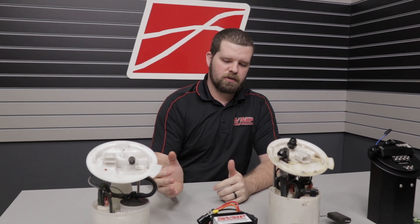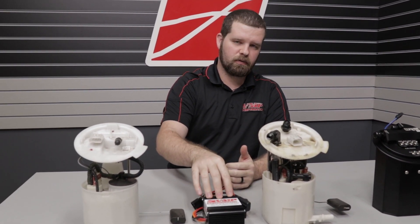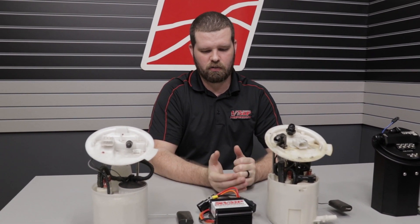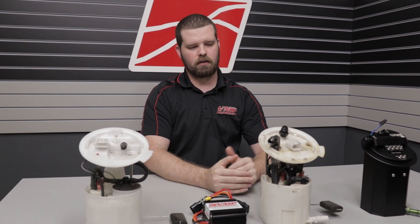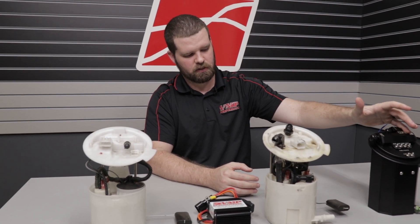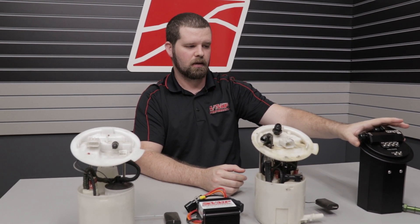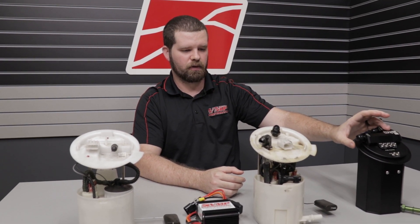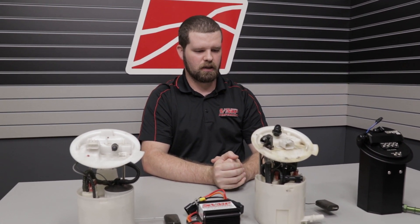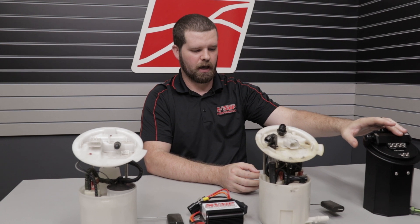In conclusion, we have every option you need — from the mild setup where you're just using a fuel pump booster on a stock fuel pump assembly, which goes through GT500s as well. The pricing is different for GT500s since they all require two fuel pump boosters, with the exception of the 2011-2012s which require one and two separate harnesses. This is the midway option that a lot of people do, eventually upgrading to the final solution — an aftermarket return-style hat. Options in this range are typically $1,050 to $1,500. Our plug-and-play fuel system with a return-style hat and twin 274 pumps is $1,650.